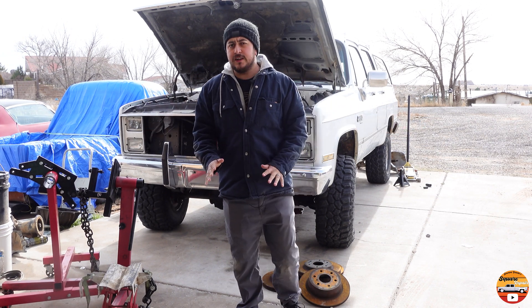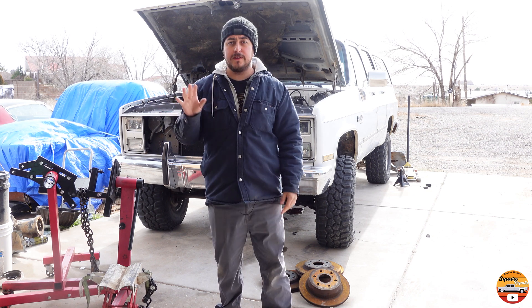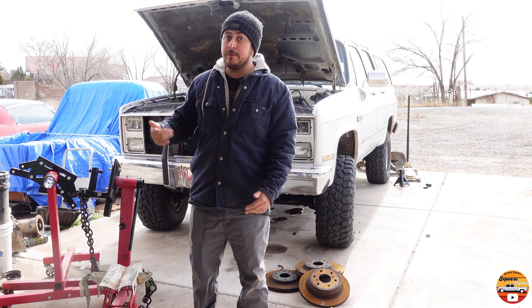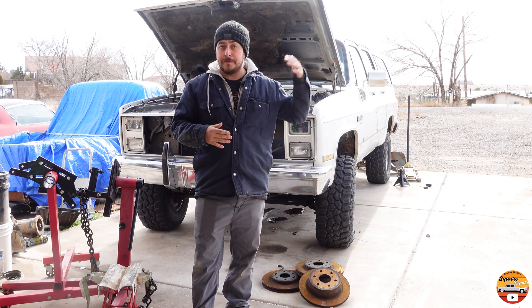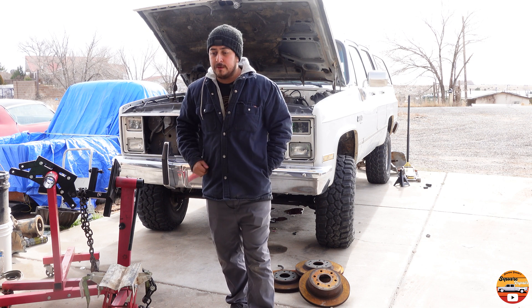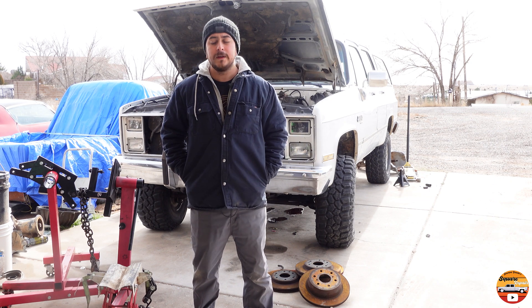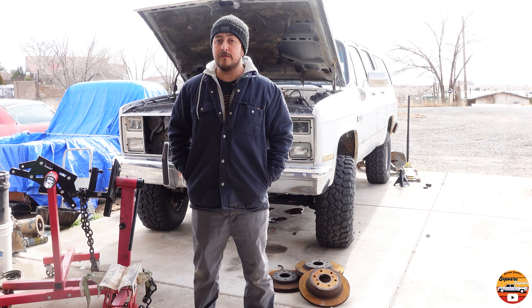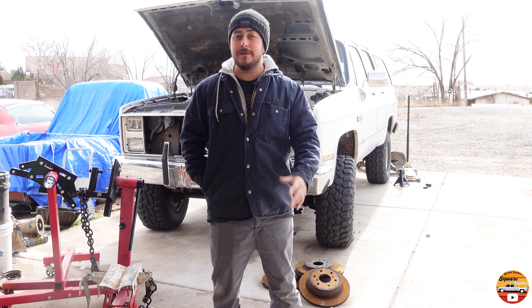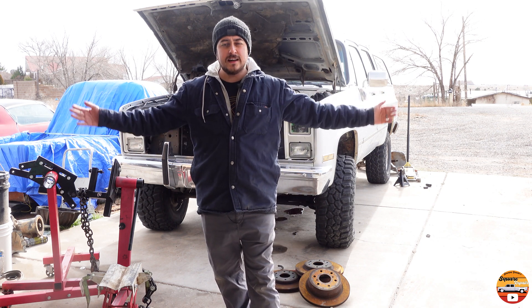That pretty much wraps everything up as far as the fuel system goes. A lot of people are really scared of this step but it's not complicated at all. This setup with the 3/8 fuel line will get you right up to 300-400 horsepower naturally aspirated. If you're planning on going bigger, you might as well start off bigger - use dash 8 or 10 fuel line, stepping up to about half an inch, and that system will support you well into the 600-800 horsepower range. Then obviously increase your fuel pump size as well. There's a lot of stuff left to do on this vehicle but we're getting pretty close to being able to fire this thing off. Definitely come back for episode three where we're going to get this thing running. My name is Giovanni Dante-Grego, I am your host of Square Repair. I hope to see you guys again in the next episode. Keep on trucking, everyone.